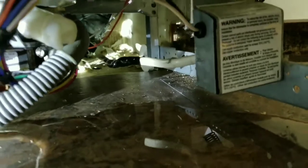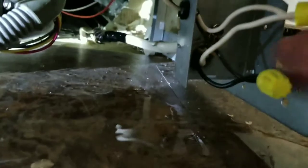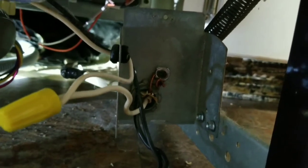Now let's see if we can find where that electrical goes. Here is the electrical wire — it looks like it's been taped before — going into this box. You need to get into this box. There's a screw on the top. Take that loose. And your wire nuts — everybody knows how to use those. This is just a 110 dishwasher. And a ground — there's a ground screw. Disconnect your wires and hopefully the electric's off. Wire nuts are off. Ground is loose.